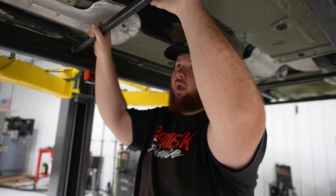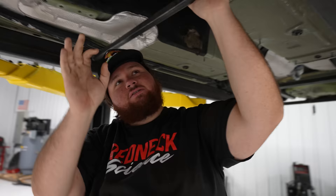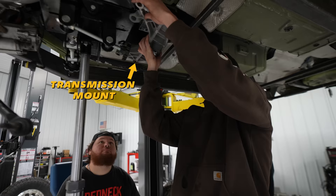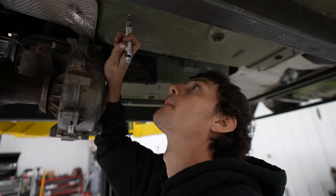You might be wondering what's happening here. We're making this four-wheel drive — putting in a different transmission and a different transfer case so it can run power to the front axle. The problem is this is a car, not designed for a big transfer case and four-wheel-drive transmission to fit inside it. Something has to compromise, and I have a feeling it's going to be the floorboard — right where the driver puts his feet and the seat. Good news: the turbo 400 fits magnificently, so the transmission is not an issue. The issue now is the transfer case — we've got a lot of floorboard to chop out.